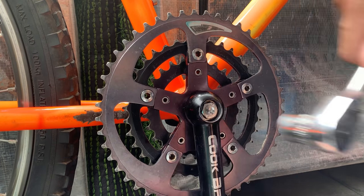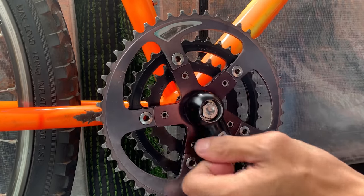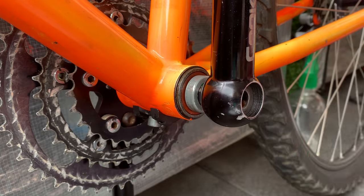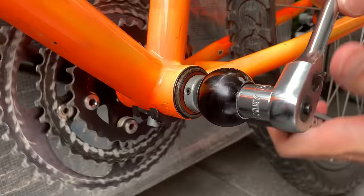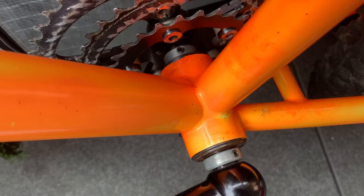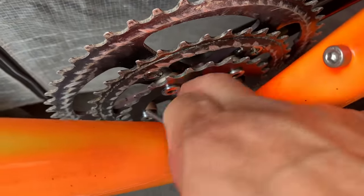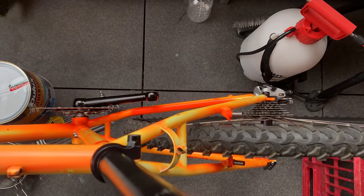So with the bottom bracket, you've got those two little spindles. Basically, you just leave them loose, those circular clamps you can see there. You just have them loose for now, then fit the cranks on, adjust your chain line, and then tighten up those washers after. Here I'm showing you these washers are loose, which is a pretty cool feature. You can always adjust your chain line even if you don't get it on straight.